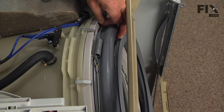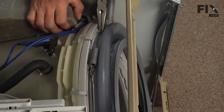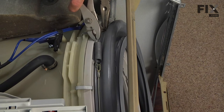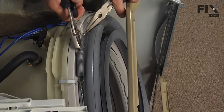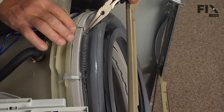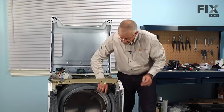With our needle nose pliers, grasp the other end of that wire band right by the hook, and basically force that onto the lip of the bellows. Take the second pair of pliers, grasp that spring, get a good firm grip on it, and pull it towards you. Keep in mind that the band won't stretch, only the spring, so don't try to move the lower portion of it. As it engages, make sure that it sits firmly up against the tub cover, then go around and check that the band stayed in the V-groove all the way around.